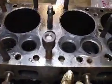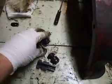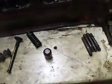The one exhaust valve that I was telling you I had so much problems with — I finally got disgusted and actually cut the spring with the air tool so I could get a good direct hit and push it up out of the valve. It was unbelievable. I normally don't like to destruct things, but I wasted like two hours on that thing trying to get it out the normal way.